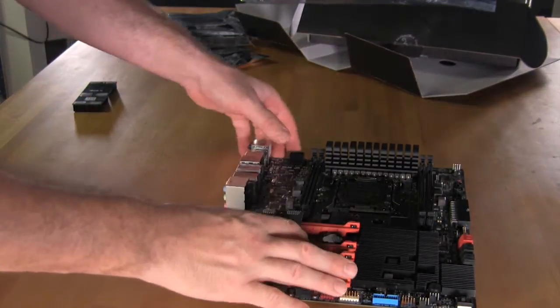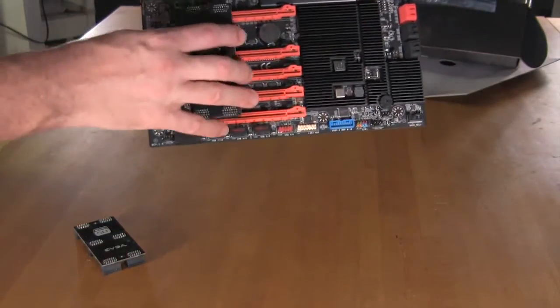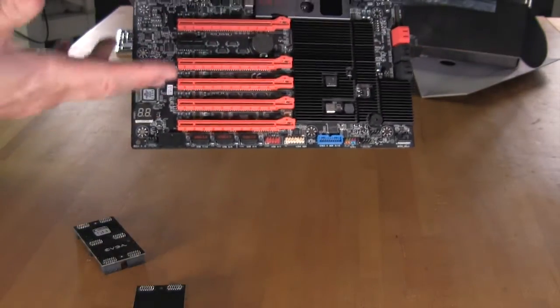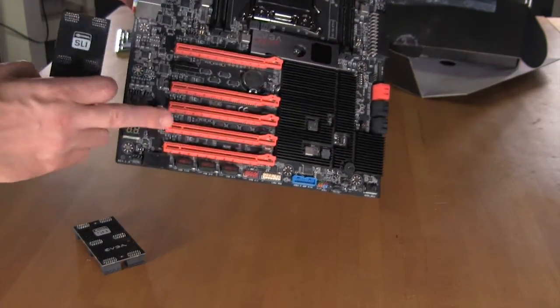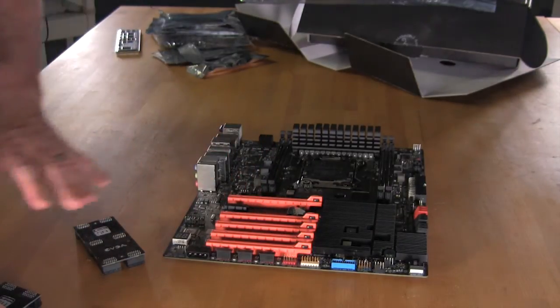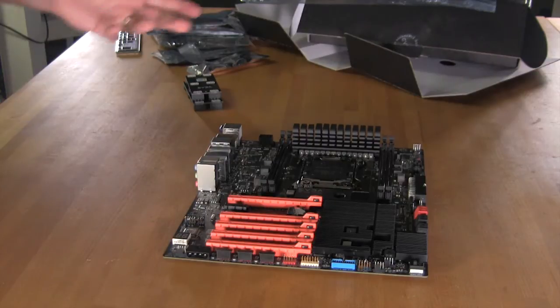To show you how that works: if you're running the normal bridge, you're going to get slots one, two, and slot four for your SLI. If you run the larger one, you're going to get slots one, two, and four — or slots one, two, and five. Looking at their layout and product materials, what you would do is run slots one and two, and then put your additional physics card most likely in slot number four. Slot four is far enough away that you can still run dual-height coolers on each card without obstacles. That gives you your best options for running SLI with an extra card to handle physics processing — that's Nvidia PhysX, not standard physics like Havok that relies on the CPU.